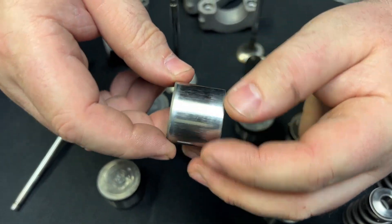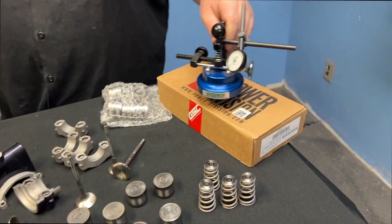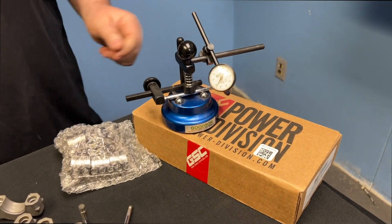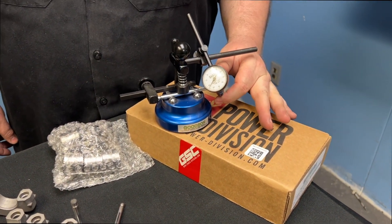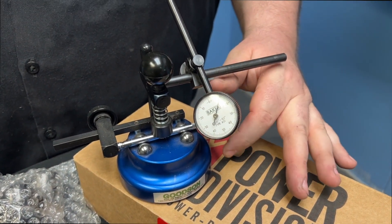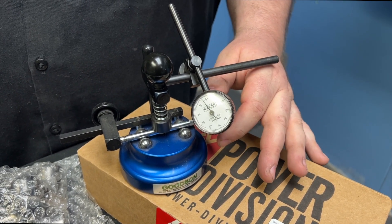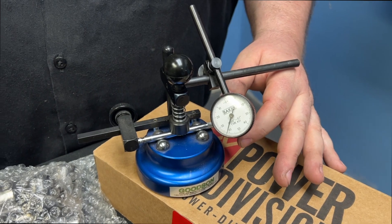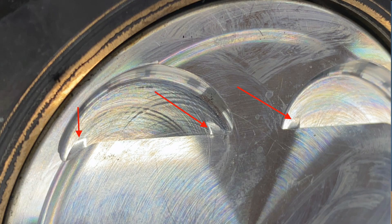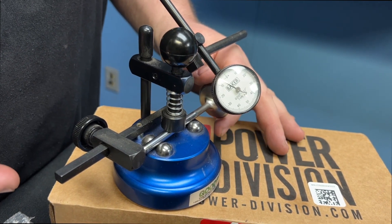I don't care what material you have — nothing is going to survive not having oil for very long. We also had some bent valves, and a bent valve is definitely going to cause issues. Tom did not check piston-to-valve clearance. What we think happened was when he assembled it, he did not put the pistons down far enough and he tagged a couple of valves. These valves were open during assembly and they tagged each other — there were marks in the pistons — and he was trying to compensate for that.